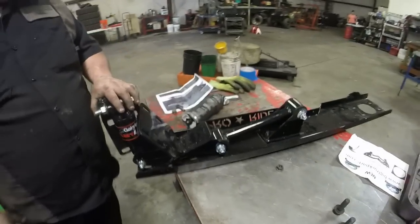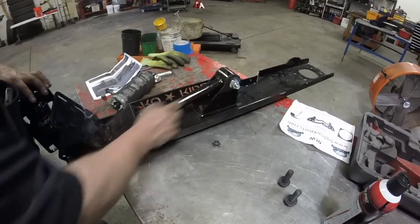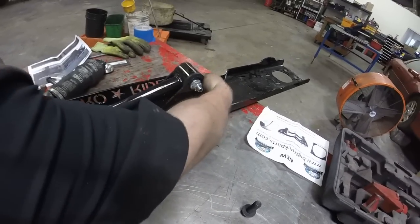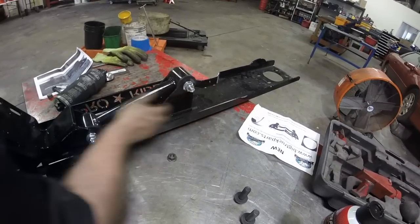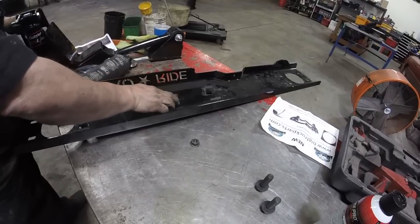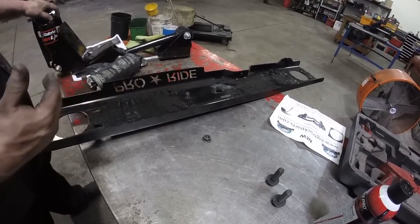All right, what you got? You got to flip back over. Yeah, I flipped it over and was going to take this bolt here loose, but then I noticed these nuts under here. So I took these nuts loose. And when I removed this bar, I found the slotted plate. Slotted, yeah. So that's how you're going to adjust your side to side on your cab.